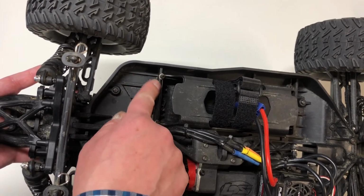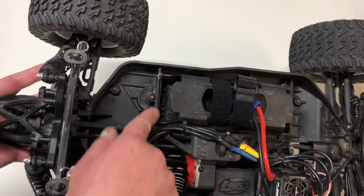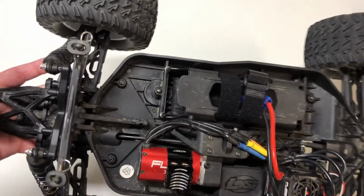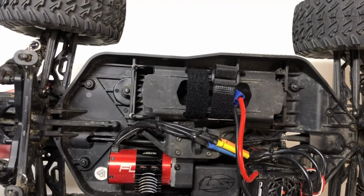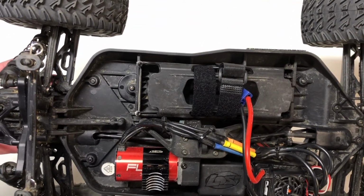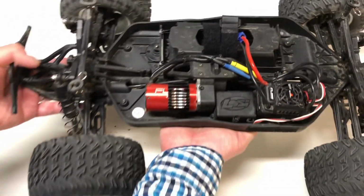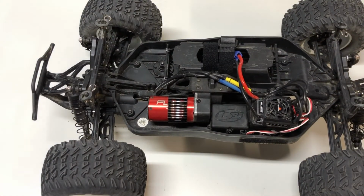The chassis does have these little plastic wedges in the corner to try to hold that battery door back, but I found that those basically wore down really fast. So using little metal washers and little metal screws helps quite a bit, and is now a lot more of a permanent solution. So that's tip number 6. Little battery door stops so your battery tray doesn't just pop through.